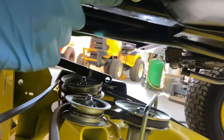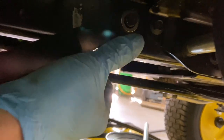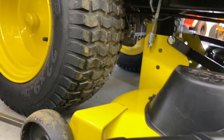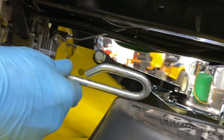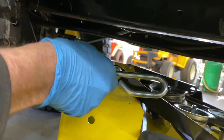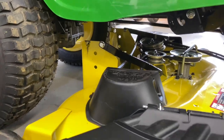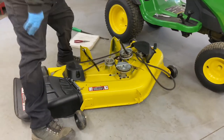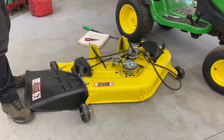Okay, so we're on the right side. We're going to pull this pin out right here — might be a little bit hard to see. I'm just going to put my thumb over it while taking this right off; the washer will fall into my hand. Take the rod down, go to the back, turn this guy sideways, pull it up, and washer. This one's tight so I'm just going to lift up on the back with the pry bar. Turn 90 degrees — comes right out. And now you should be able to just pull this right on out, slide it out.